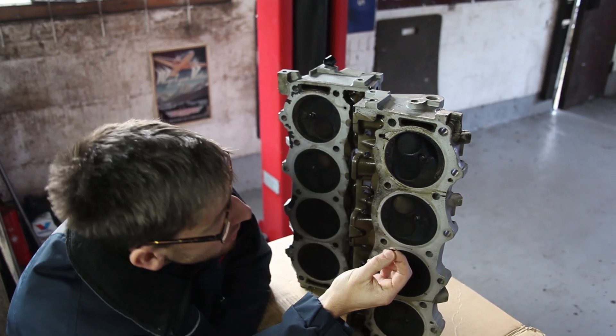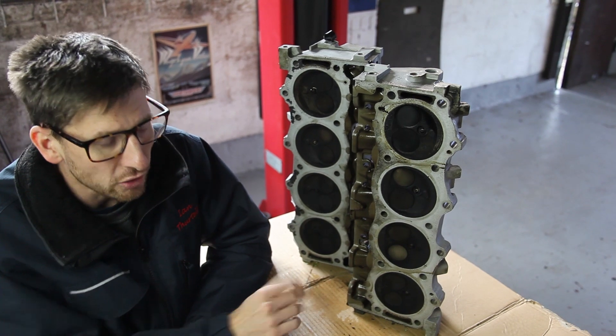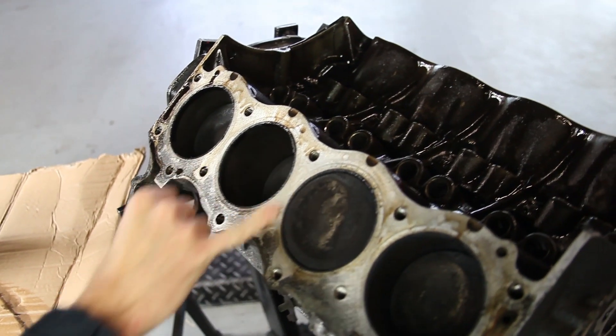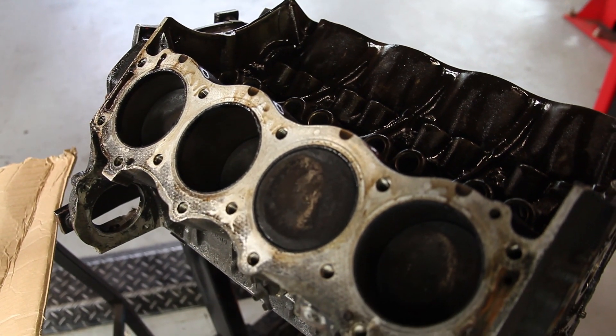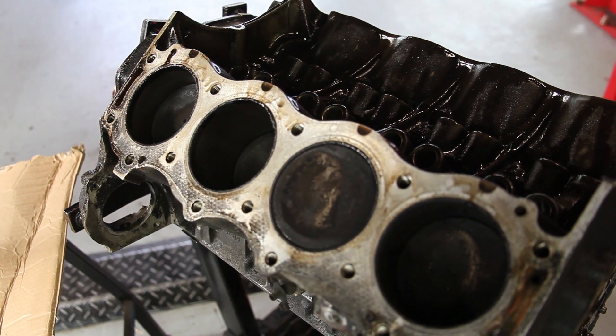This one's been consuming oil by the looks of it a little bit as well. And on the top of the pistons you can see we aren't getting a very efficient burn of fuel, because we're getting lots of carbon build up dark around the outside, and on the centre of the piston getting very hot, very white. So we're not getting a very good mixture of air and fuel, not getting a decent spark to burn that fuel either.